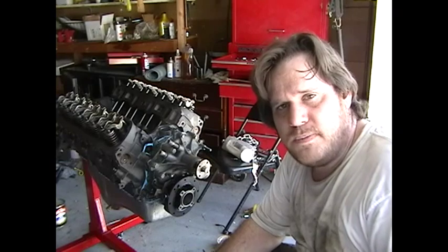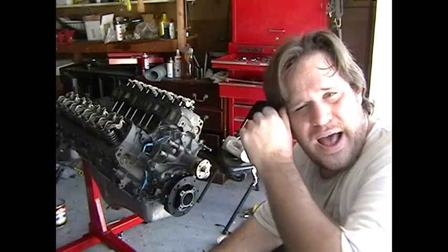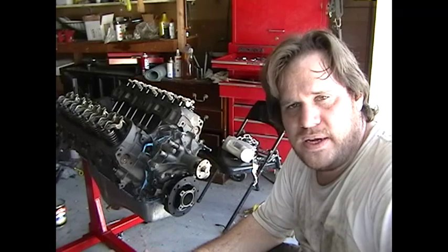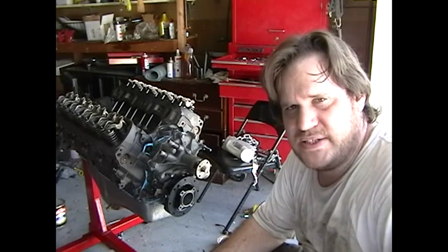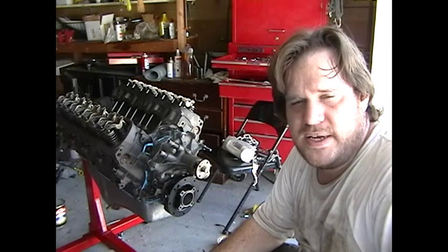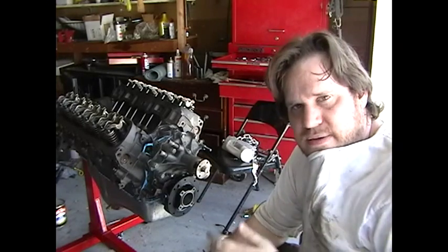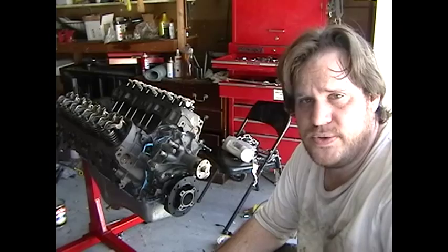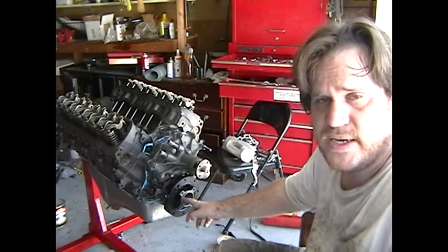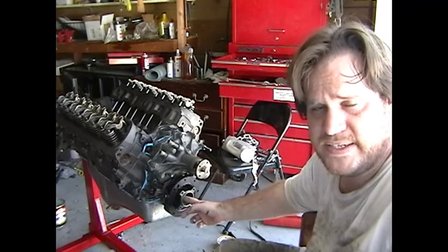I noticed that after cleaning it real well, the bolt went a lot further in, and I was able to put the proper amount of torque, which was 90 pounds. Before, I remember it reached 90 pounds very quickly, and I had to put more and more just to get it in. So basically, clean out your threads, clean the threads on the bolt really well. Take a wire brush, scrub it really good. Take your time and do that real well. And the bolt went right in, and now it's actually tight and butted against the washer.